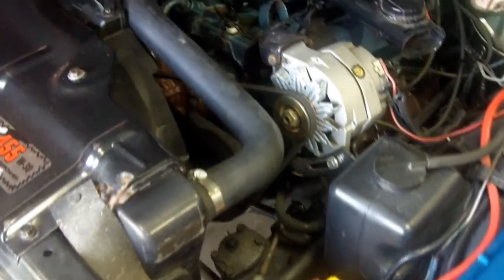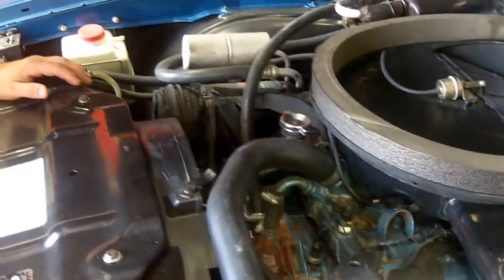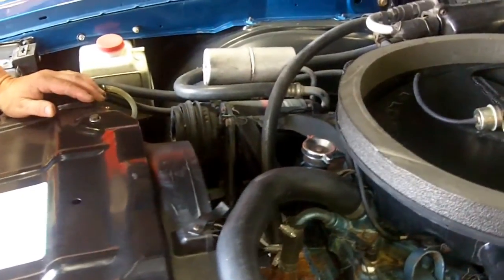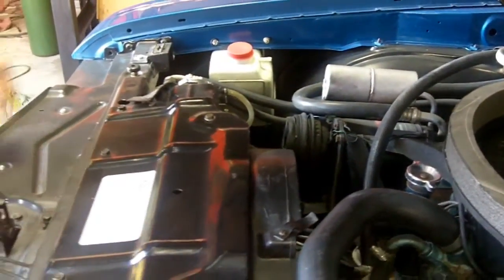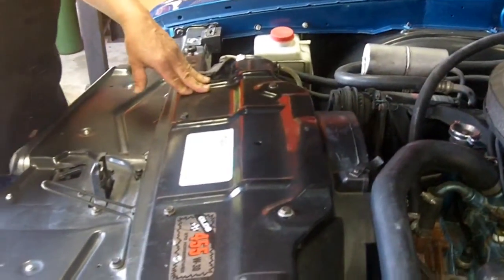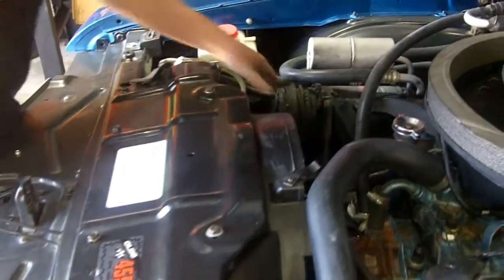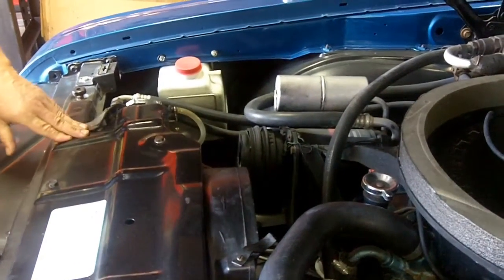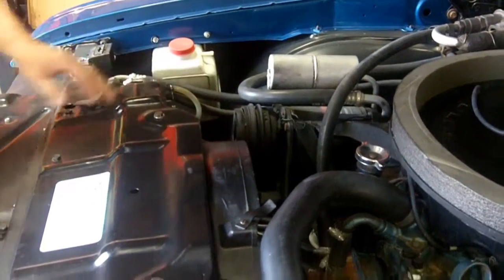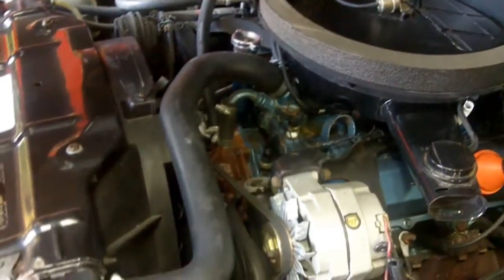We've got all the air conditioning stuff here. Looks like the clutch is out on the AC compressor, so the belt's off. Looks like all the hoses are there, the condenser's there. I'm seeing most of the parts for the AC. Maybe needs an AC pump. Feels like that baby's, oh, it's not froze up. Definitely needs a clutch though. Alternator looks new. Super car, beautiful under the hood.